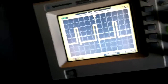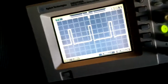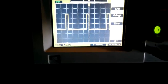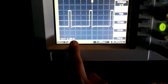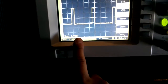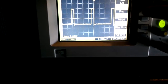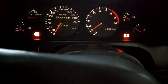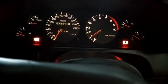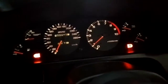Here's the tachometer signal — it's just a square wave. If we look at the peak-to-peak voltage, it's about 7 volts peak to peak. Let's look at the frequency: it's about 54 hertz and it's revving at about 1,000 RPM. So it goes up by 50 hertz for every 1,000 RPM. I'm going to rev it to 2,000 and it should be about 100 hertz.